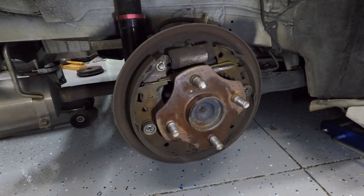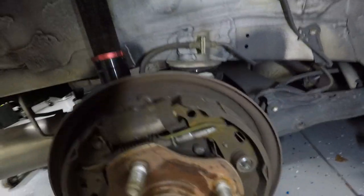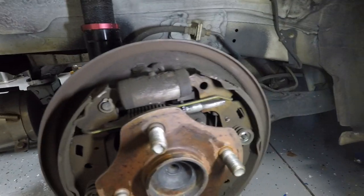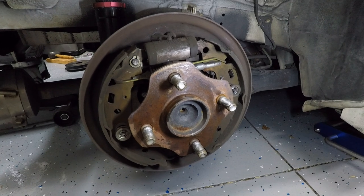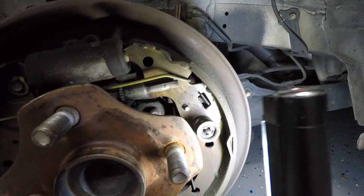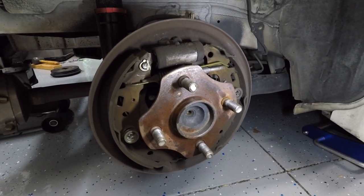Now I'll go over shoe replacement. Your brake drums are going to have two shoes — one on the left, one on the right. It's pretty tricky. With a brake drum there is a ton of springs and little levers and clips you've got to get around to get the shoes off. First thing you do before you tackle something like this is take a ton of photos — important close-up photos of how it looks before you disassemble it. Or at the very least do one wheel at a time so you have a reference point.